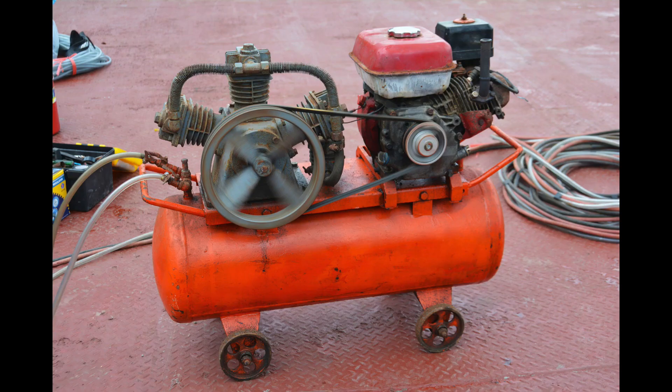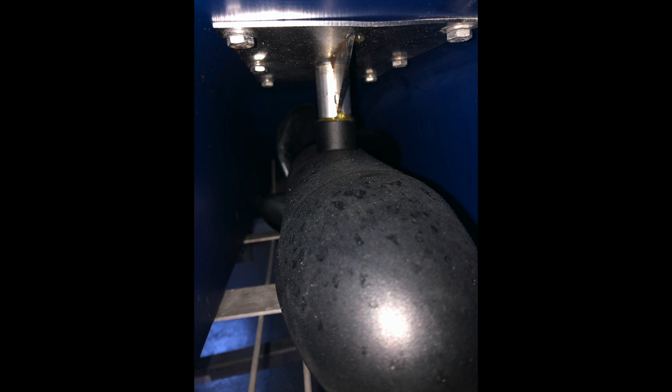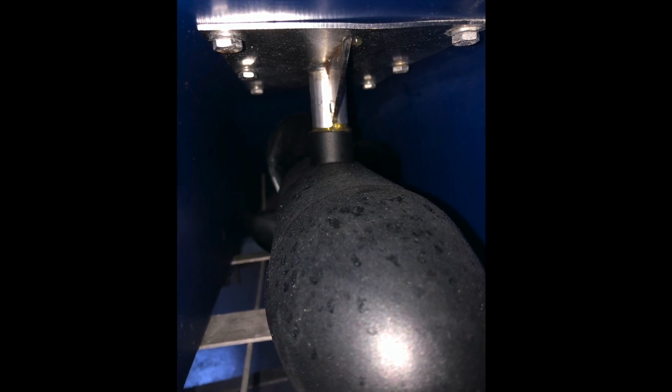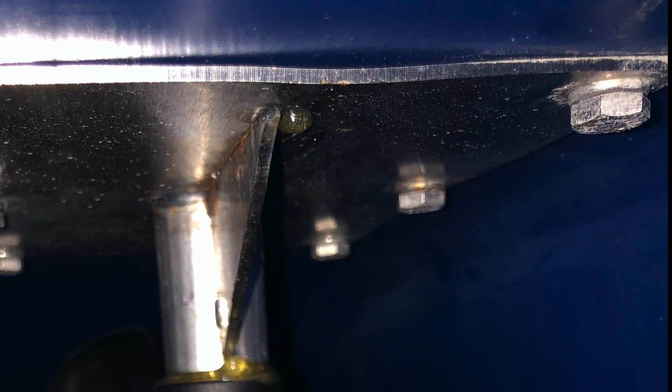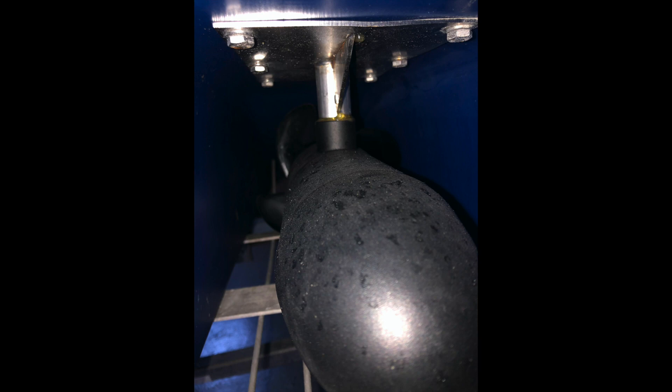I even added compressed air via the drain plug and did not notice any air escaping around the seal. I'm making the assumption that water is getting by the motor mount and getting into the hull. I did watch your 'need some love' video the other day, but did not notice any weld cracking on the post attached to the plate. But I did notice the plate on the forward side appears to not sit flat to the boat hull — see the attached picture. I'm on the fence about pulling the plate, flattening and resealing it versus simply caulking the visible void. I would love your opinion.